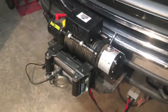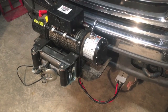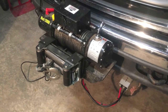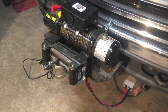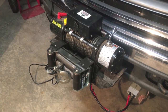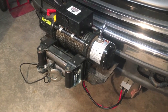The reason that matters is you've got to make sure your connection is going to be big enough for your winch. This winch, according to the manufacturer, can draw 480 amps at full load, so you want to make sure your connectors can handle that. The other reason I like the SB350 better than the SB175 is because I ran power to the rear of my truck as well as to the front. Going to the rear, I had to use a lot more cable, and to carry the amperage that far I had to use a much bigger cable — and the physically larger cable would not fit inside the contact tips of the SB175 connector.